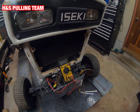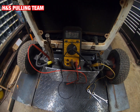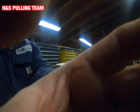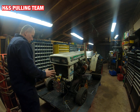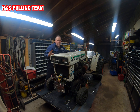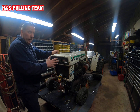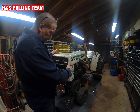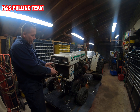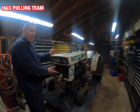Just in case you couldn't hear me over the engine — that's normally what you're going to see. You're going to have in the neighborhood of 14 volts when you're running and your alternator is supposed to be charging. The meter is slowly dropping down now that I've shut off the engine, which is what you'd expect to see.